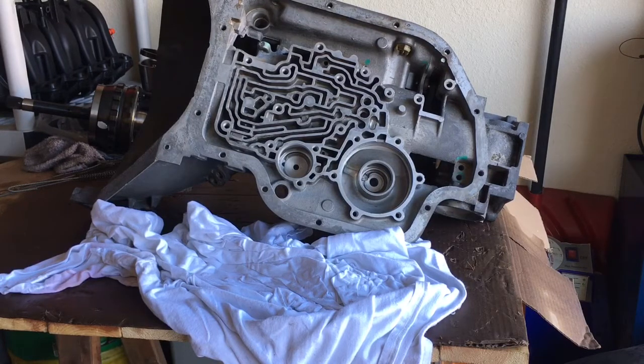The plan is to move forward with this 1969 truck Turbo 400 case and use all the innards from my 1970 Pontiac Grand Prix Turbo 400. I've got updates on my transmission and I want to update the transmission fixture for the engine stand. I'd say I have maybe a quarter to a third of the parts ordered for the Turbo 400 heavy-duty high-horsepower rebuild, and I'm still making up my mind which vendor I want to use for my clutches and steels.